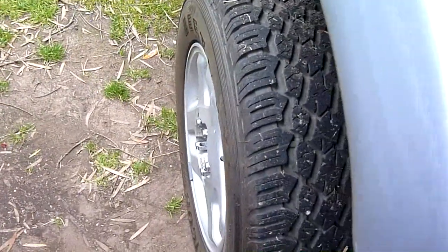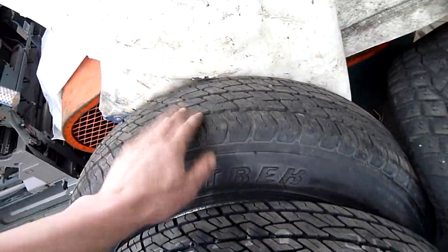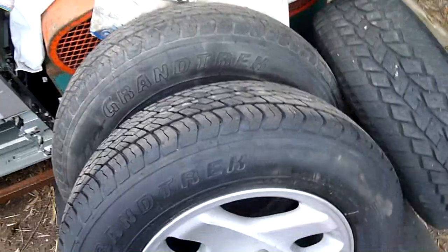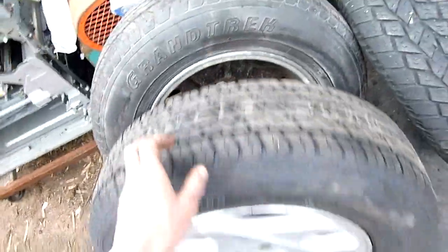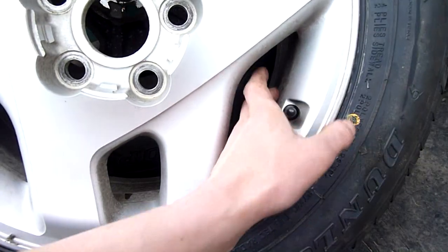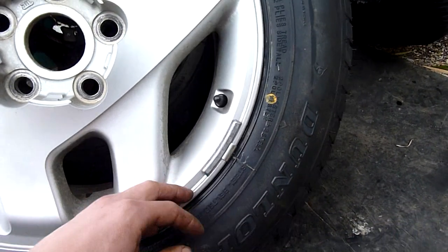Blue can have them for now. I've got about four or five tyres. That one there I scored from somewhere — I can't remember where or why. That one there's brand new, or maybe a year old. I just ordered it the other day and got them to fit it up and balance it and everything. It's a lot easier that way. They have to be balanced anyway, and unfortunately the only weights they use are on the outside of the rim. I prefer them stuck on inside but as you can see there's too much oxide and dirt on there — you wouldn't get them to stay on. So they use clip-on.